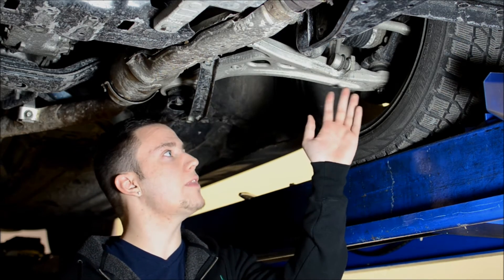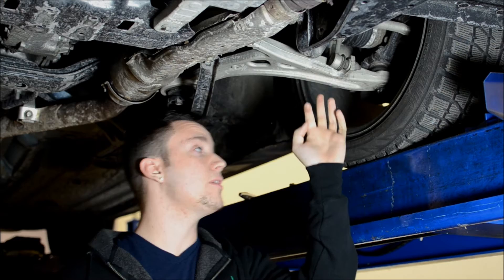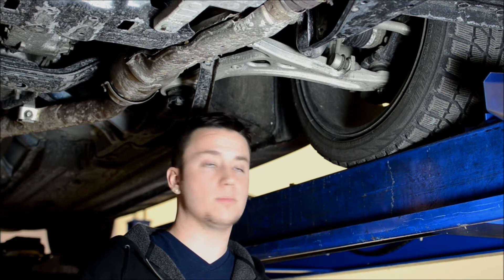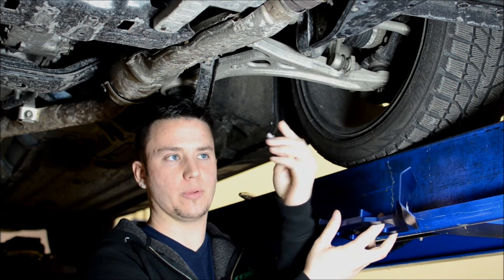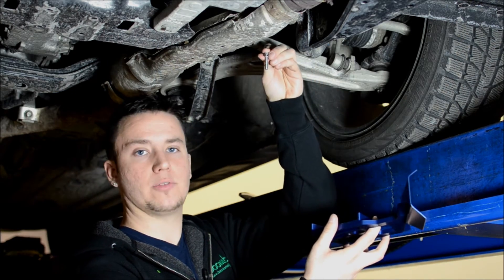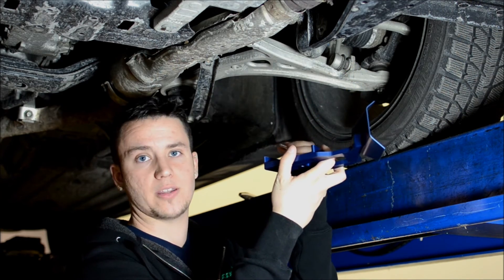If you look up under the vehicle and find the control arm that connects to your steering knuckle, you're going to see there's one hole directly in the middle of the control arm that you can see all the way through when you look up through it. This is going to be the hole that you utilize when you mount your brake deflector to the vehicle. We've got our brake deflector here followed by a 5mm allen-headed bolt with a washer on it. This is going to drop through the top side of your control arm and screw directly into the deflector from underneath. Let me mock everything up and show you guys how that goes together.